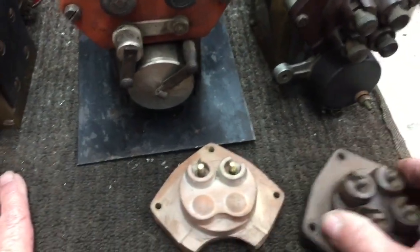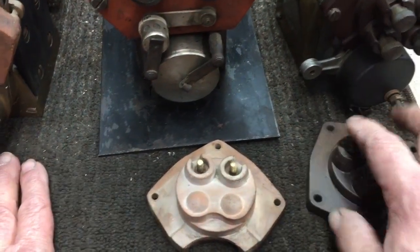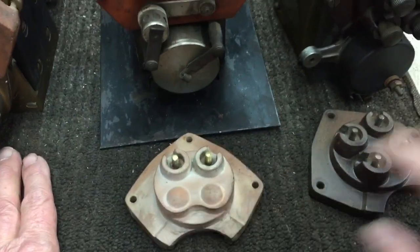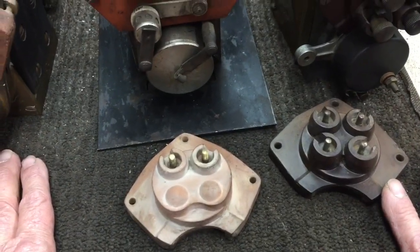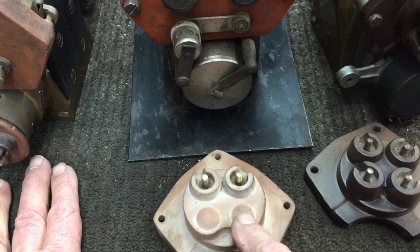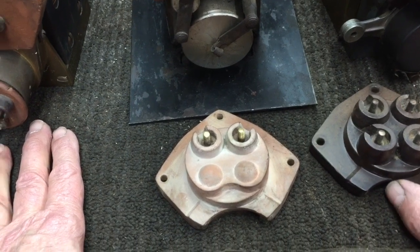So there's the difference between the two and four cylinder. Two cylinder, four cylinder — different on the outside, pretty much the same on the inside. On the two-cylinder these two are grounded; on the four-cylinder none of them are grounded. There is one other type of two-cylinder cap — that's where the spark plug terminals are kind of kitty-corner. Those are the 360 cap, and they're quite rare.